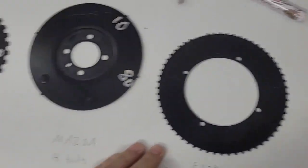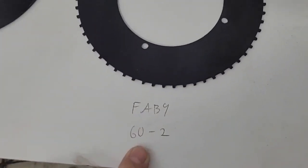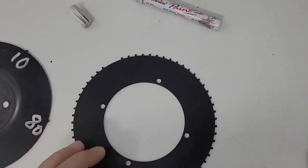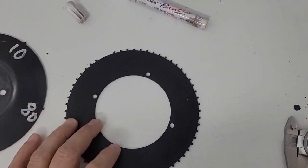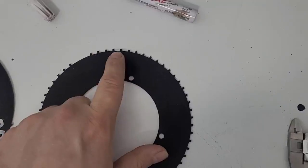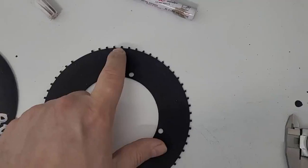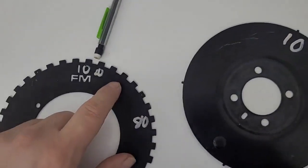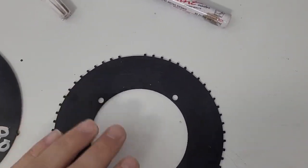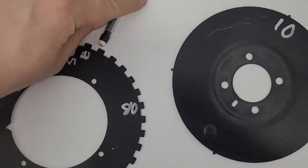So the math shows more teeth is better - why not use this one? This Fab9 wheel has around 60 teeth, so that's about 6 degrees per tooth. The worst you'd ever have to guess is about 5.9 degrees before getting another tooth, versus about 9.9 degrees with the 36-2 wheel. So this should be even better - but it's not. Let's talk about why.